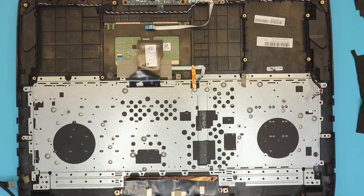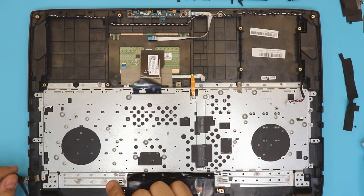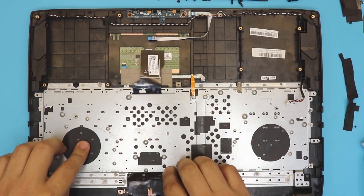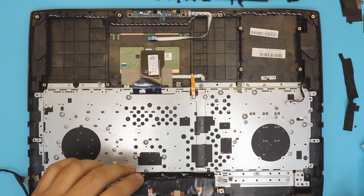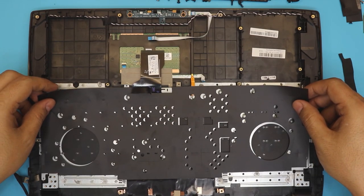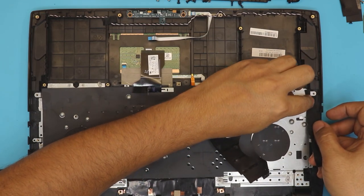Now that we've put the plate back — I melted some plastic, both black and white, using a plastic rod — the motherboard will grip from this space, which in turn grips the keyboard, and in some corners it will grab from the plastic posts. After putting the plastics in the holes, grab the cover and put the protective cover back on. Before that, put the isolating tape in place.